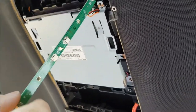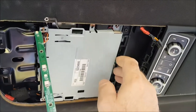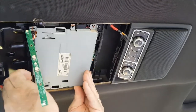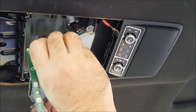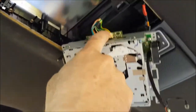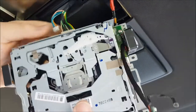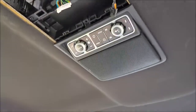With the PCB off, go ahead and remove the unit from the roof. It's more useful to pull from the sides rather than the back. Grabbing it from the sides, you'll see the back of the unit is attached by two plugs — just press in and pull those out, and the unit will come free of the roof. You can now proceed to repair or replace the unit — it's completely uninstalled.